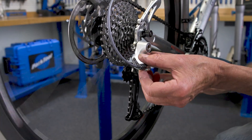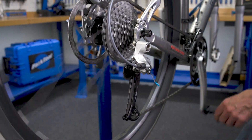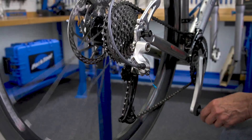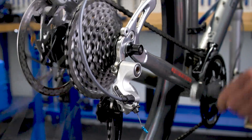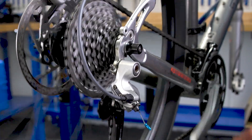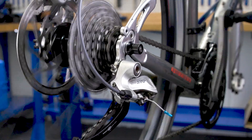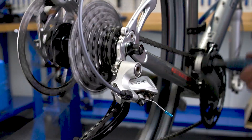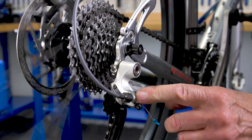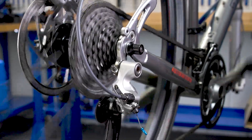I need that extra one in between. I'm going to go back in. That is pretty much where we were — it seems to work okay. Now let's go slackness. We're shooting to slacken the system, starting all the way slack. One click does not get us one gear — there's my click, no gear. A second click, I did get my gear, but it's going to be messing up at the bottom — I'm out of clicks because I wasted one at the top. I'll put it back where it was. Moving this adjusts the pulley position underneath the sprocket — that aspect is the same.